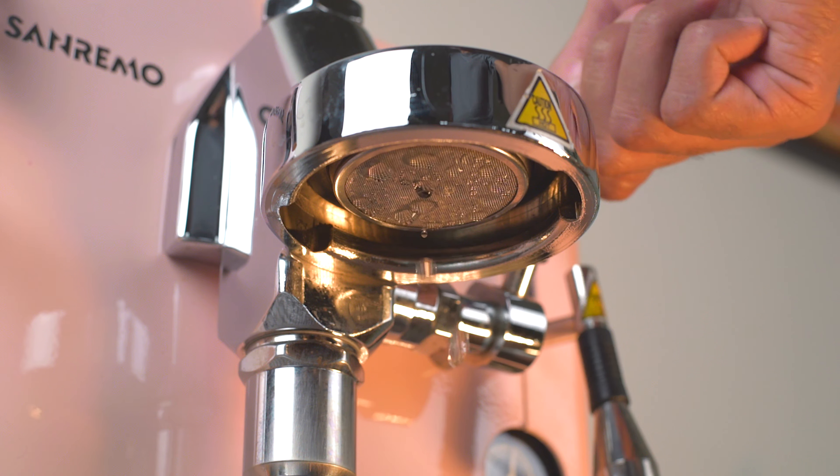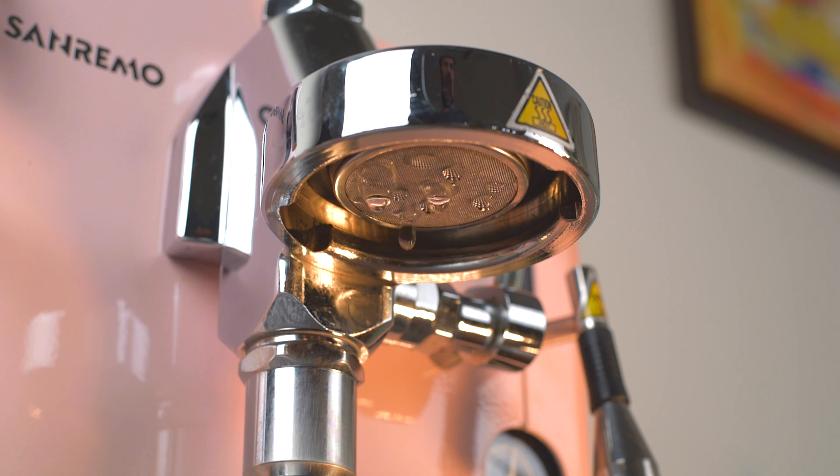So don't be trashing on heat exchanger machines before you've taken a second to understand how they work and how to get good results from them. The Cube uses an E61 group head, which is very popular and very old — it's been around since 1961 and could really use a proper upgrade, but that's a debate for another day. As far as E61 goes, this performs just fine. The lower end V model has a vibration pump, which is cheaper and easier to replace, but also less powerful and less consistent in its pressure delivery and has a shorter lifespan. It does have a gentler ramp up to pressure though, which can help mitigate channeling.